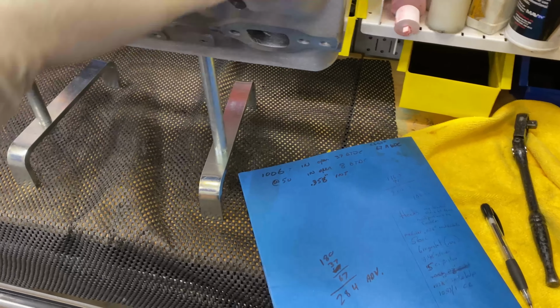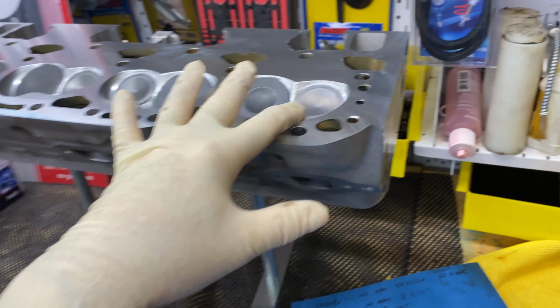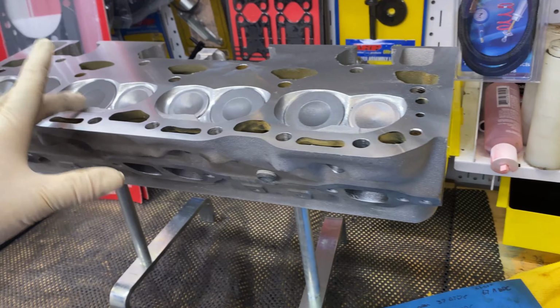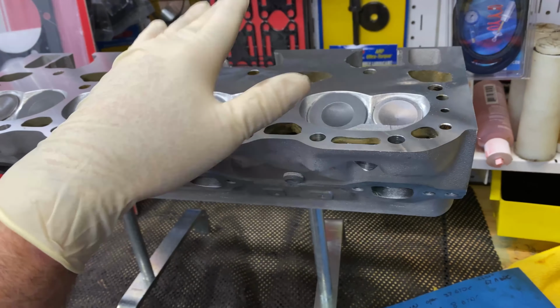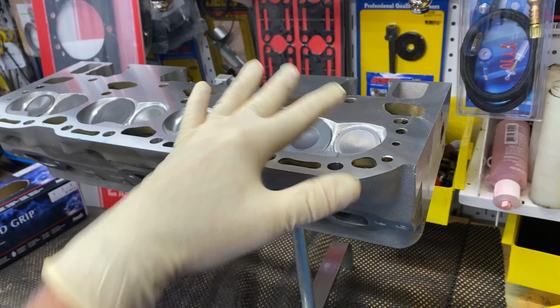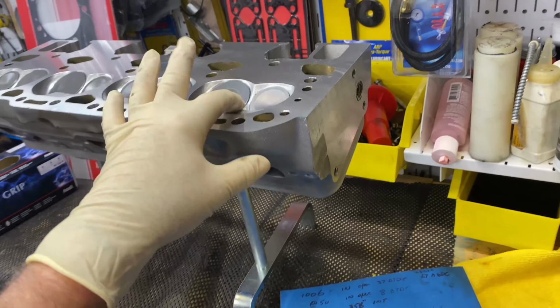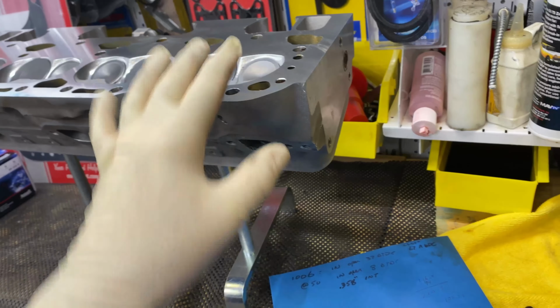Okay, if you wonder, it's just plus or minus 1 cc. This isn't done to be exactly precise, so I don't spend time doing every one. But I do know the method I use gets me within 1 cc. So I figure it's 56 cc's for the chamber.